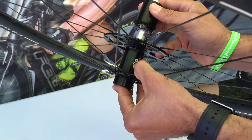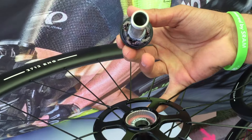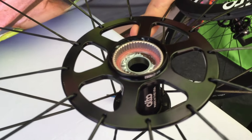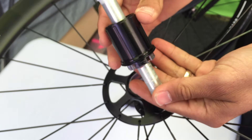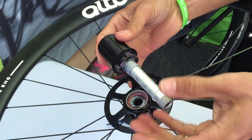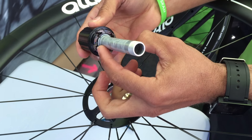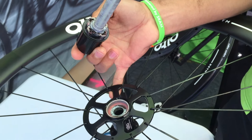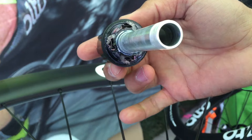Tested to 40,000 miles at 400 pounds with an unlimited rider weight rating. Then you have your freehub, one-piece axle — this is pressed onto the axle like that. You have your spacer sleeve that runs between the bearing and the shell bearing, and three individual teeth per pawl on four pawls on a 48-tooth internal ratchet ring.